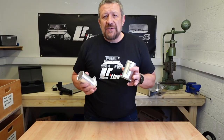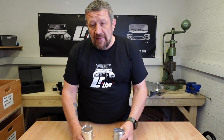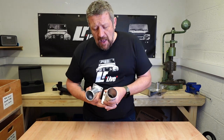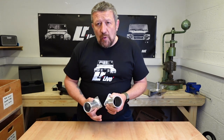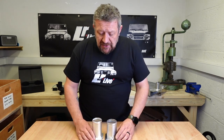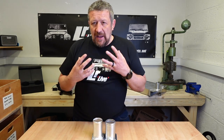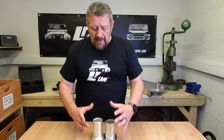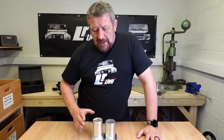One of the key elements to restrictive performance on a TD5 is the EGR valve. Without going into environmental implications, an EGR valve will recirculate gases that are dirty and hot into your engine. That's not ideal because engines love to have nice dense clean air, so blanking off the EGR valve means the gases will get expelled from the vehicle rather than be recirculated.